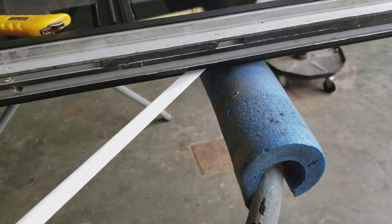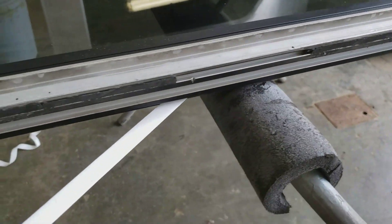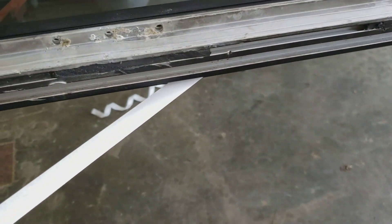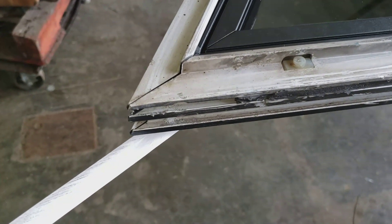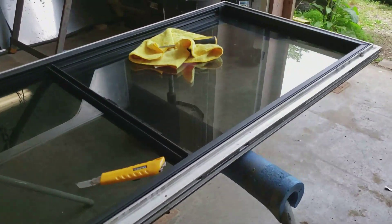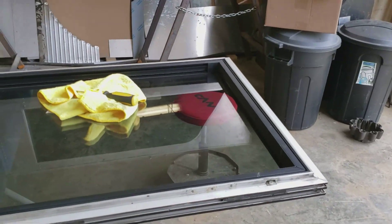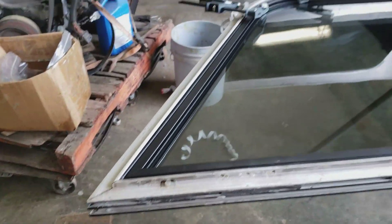I'm pulling the cover tape out from between the frame and the two-sided tape, then going along and squeezing it down right up against it. I'm not going to put the screws in until after the window is installed — I'm thinking that'll allow the window to move a little bit in there if it needs to. Once it's all installed I'll put the screws in holding the window to the frame. So far so good — now I just have to get it in the bus.